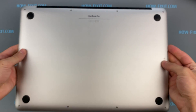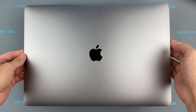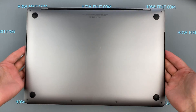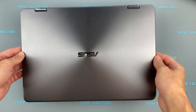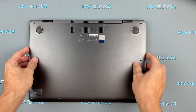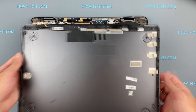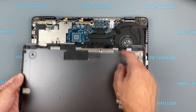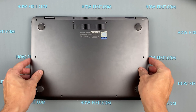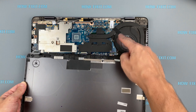It is the same with Apple MacBook Pro and Apple MacBook Air — the bottom cover has no ventilation grills, and the only thing that can help is cleaning the dust and replacing the thermal paste. The next laptop is the ASUS UX461, which is a very interesting case. The bottom cover has a visible ventilation grill, but if you remove the cover, you can see that the grill doesn't give direct access to blow the cooling system. So the cooling pad is not effective here — before buying, always make sure the ventilation grill gives access to the laptop cooling system.